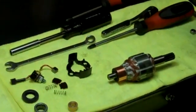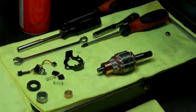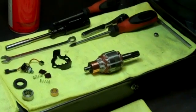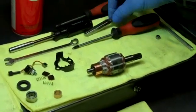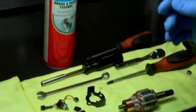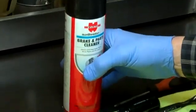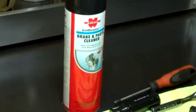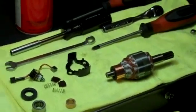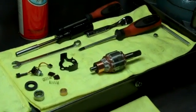You should get your tools arranged first — it doesn't take much for this job. You're going to need an 8mm socket, a 10mm wrench, an open end or a box end, a ratchet for the socket assembly, a screwdriver, and some contact cleaner. This is a good brand called Worth Brake and Parts Cleaner; we use Zep Brake Wash here. I would not use carburetor cleaner — a lot of carburetor cleaners are very strong and can damage O-rings and plastic and rubber pieces.